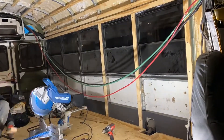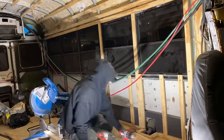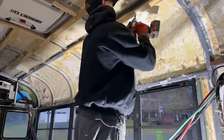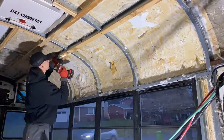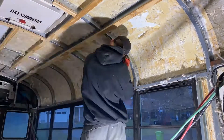It's also important to mention that if you don't just want to rely on screwing into the metal, you can definitely throw an adhesive on there. What we found to work really well on the bus is using silicone for adhesive. It gives you a really good strong hold but it also has a lot of flexibility, so when you're dealing with the vibrations of the bus the silicone holds up really well to that.